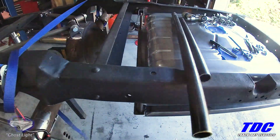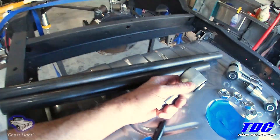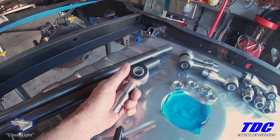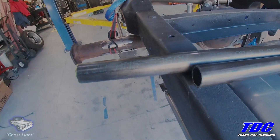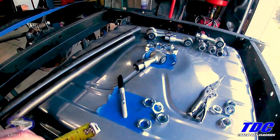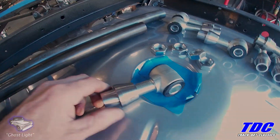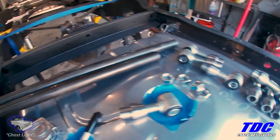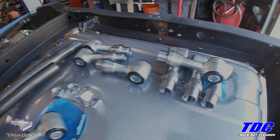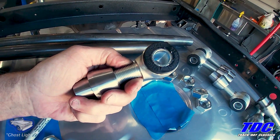To remedy that, I had these parts already. My plan was to build my own triangulated 4-link until I saw this one on sale and grabbed it. I kind of wish I just bought the pieces and put it together because that's basically what I'm going to do. The fix is to go with some 1-1/4 inch chrome moly that I have. I also picked up these rod ends from Speedway — left-hand and right-hand threaded, and I went ahead and marked them so I wouldn't put two of the same on one rod. We also have locking nuts for both sides. These are supposed to be forged instead of cast, which means they should be stronger.